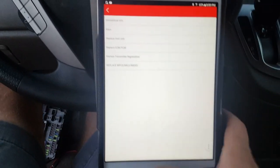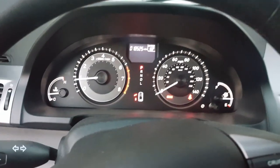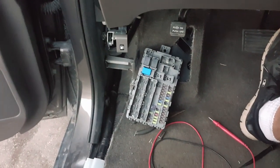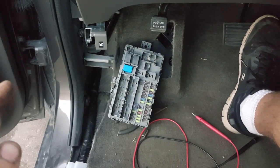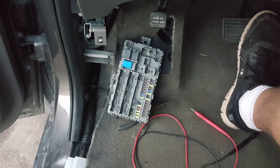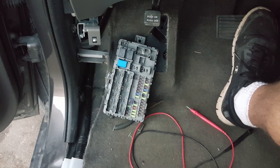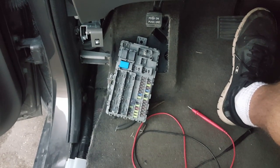You do need to have some knowledge. As you can see it's 8 o'clock — I went ahead and I'm going to remove my connector. This is proof for you. I just went ahead and replaced this MICU unit, or smart box, or fuse box. If you replace the one on the passenger side you don't have to program it, but if you replace this one on the driver's side you do have to program it. I replaced it because I don't want any issues when I sell this van — I will warranty it so I know all my modules are good working modules. Once again, this was George with Melnix Automotive. Thanks for watching — if you have any questions, shoot me an email.